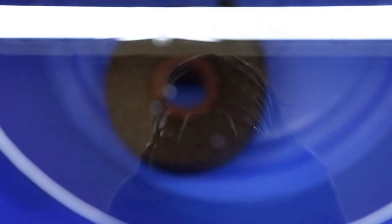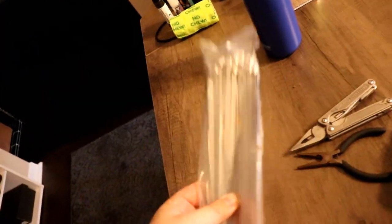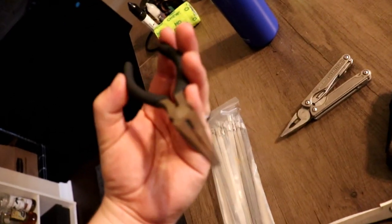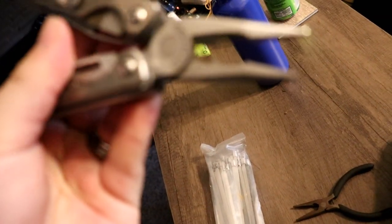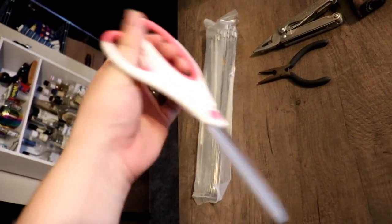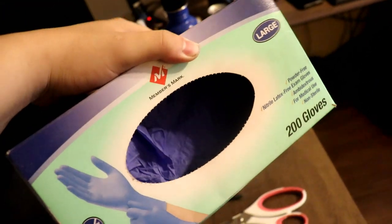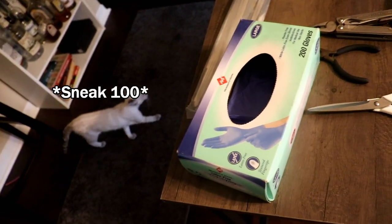First off, you're going to need a bucket with some water, and dump the heat wrap in — it needs to soak in water. You can see bubbles are still coming out; you want to wait till the bubbles pretty much go away. Other things you'll need: metal zip ties, some long nose pliers — I've got two of them. You're going to need some kind of cutting tool to cut off the excess zip ties and something to cut the exhaust wrap itself. You'll also need gloves because there's a lot of fiberglass in heat wrap, to protect you from getting splinters in your hands.